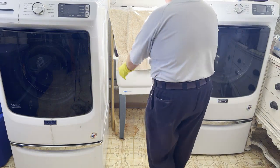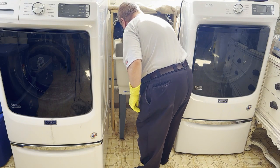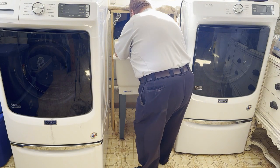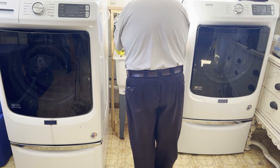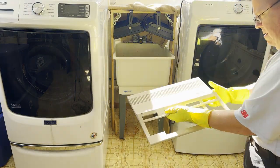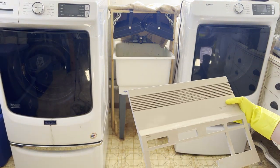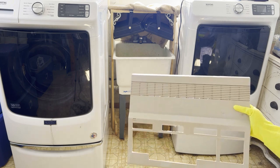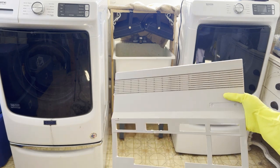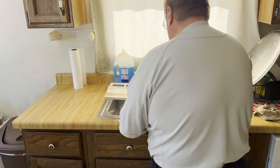Here's day two of the Retrobright. I've got the top half of the case in there, and the water was a little warmer than normal, I didn't bother cooling it down any with tap water, but it did warp a little bit. It is, however, more or less uniform. However, after I brought it out of the Retrobright tank, there was some excess peroxide in some places where it collected, and it left some marbling.